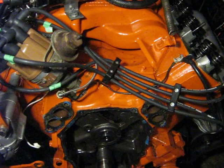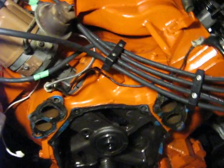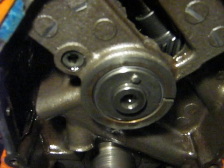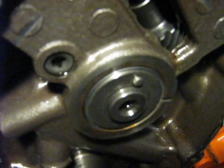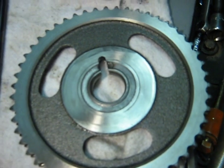Here's the 440 we had to take apart after only 300 miles. It decided to lose 40 degrees of ignition advance, and after a lot of head scratching and testing, we found we had to pull the front end off the engine. The camshaft drive pin was worn down and had spun at least a full circle.